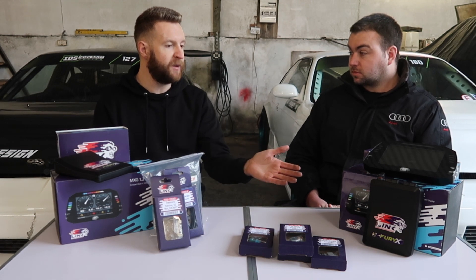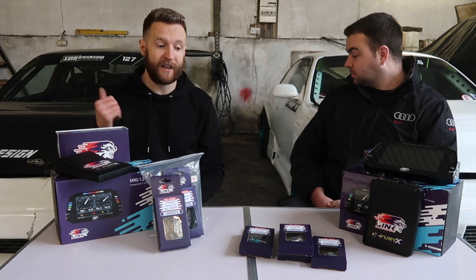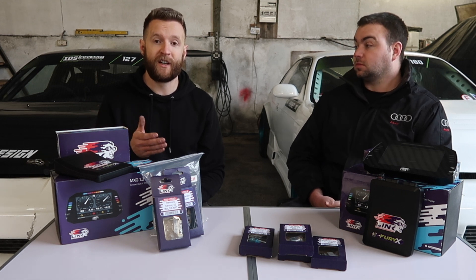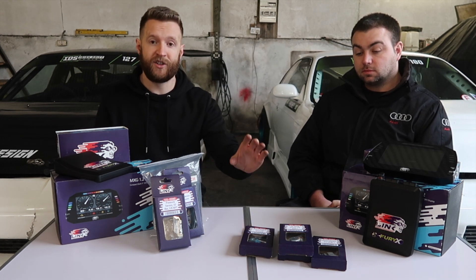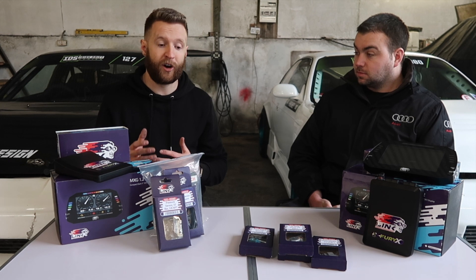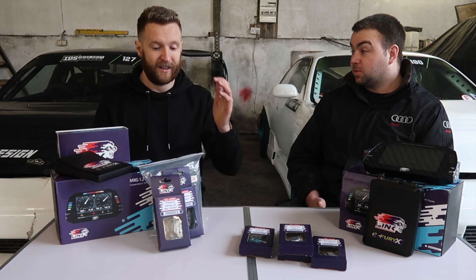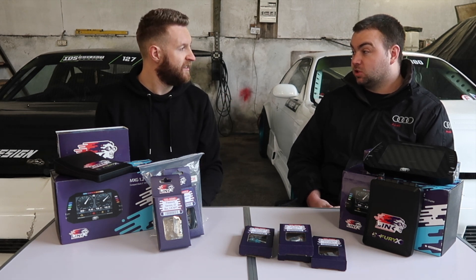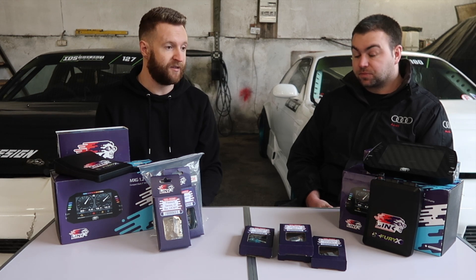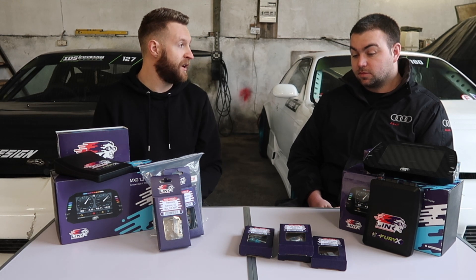And of course, we will be using a switch for higher boost in these cars as well. My car is really peaky with its power levels — at the moment they're running 1.4 bar and it comes on really aggressively. With this solenoid, you can actually just run it on spring pressure, which is about 0.8 bar, if it's raining or wet — it's a lot more controllable and easier as a driver to modulate the throttle. It's not just spinning up the rear wheels with no control. Or if you're up against a slower car in a battle, which is a big issue in competition, you can reduce the boost setting and effectively run with less power — it makes it a bit easier to control.